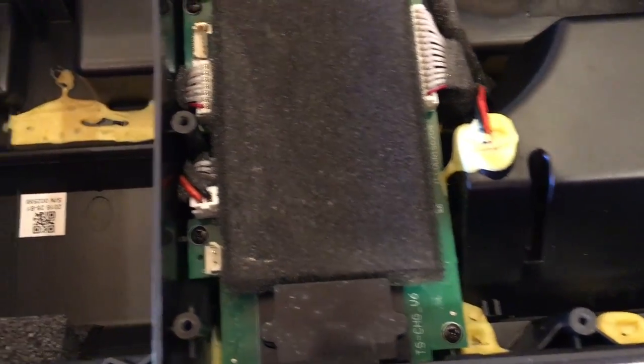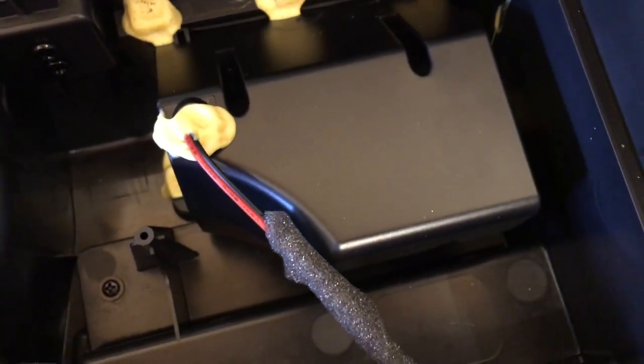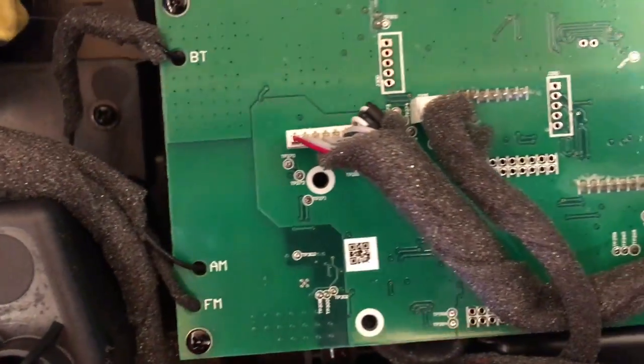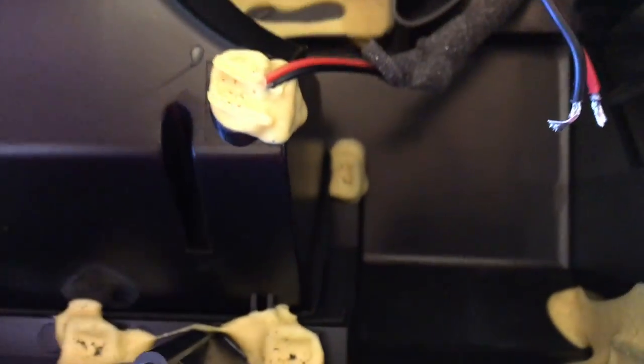You can see they protected a lot of the circuitry with polyurethane foam. I can't take much more of that apart without having a hard time reassembling it. All the areas where things meet have that poly foam protecting them. Each of the boxes you see on either end is actually protecting each of the loudspeakers — and they're all individual pods, meaning they don't share the same cavity. That's good for speakers because they work against each other when sharing a cavity, so you get better audio quality this way. Also, that antenna runs into the handle — it's an AM/FM power antenna built into the handle to give you better station reception.